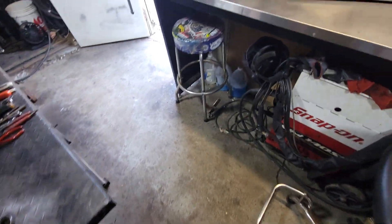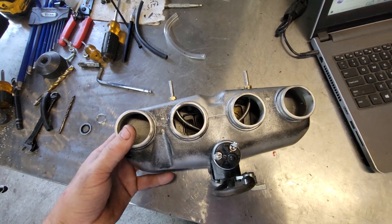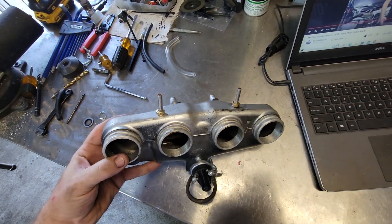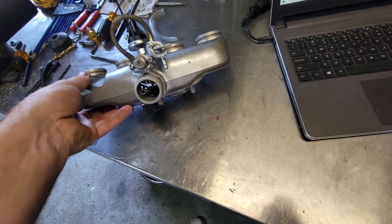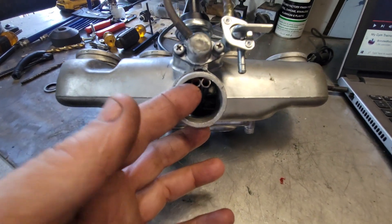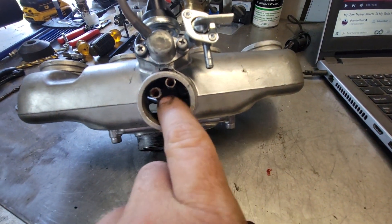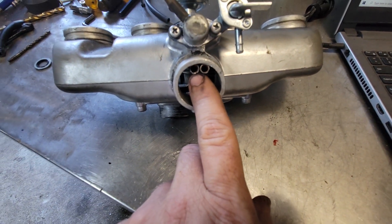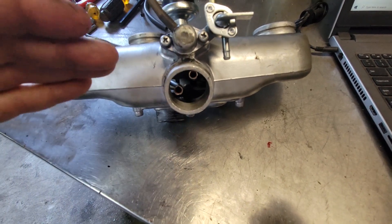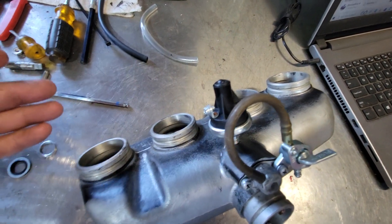What I'm working on is a charge tank. It's had quite a bit of work done to it. Got the pitot tubes poking out the top — they reference the boost down here. You can see this one sitting a bit low; this will come up. These two tubes will reference the boost coming in, and since they provide a little bit of restriction, it will be one PSI higher than the boost at all times coming into this charge tank. That's what allows the turbo to really work, along with this switch right here — I'll tell you about that in a second.